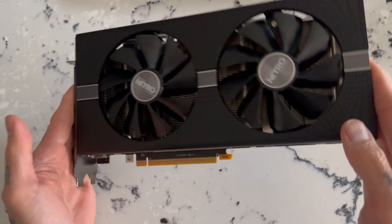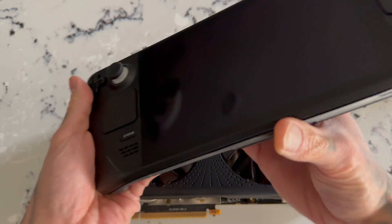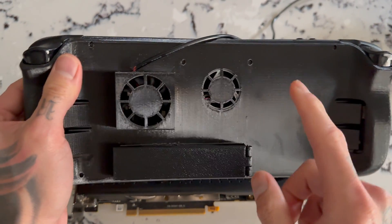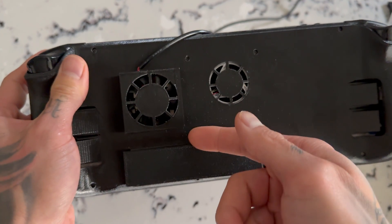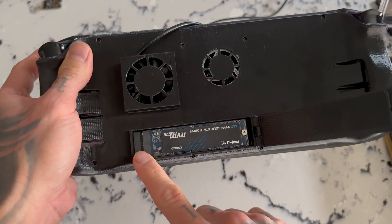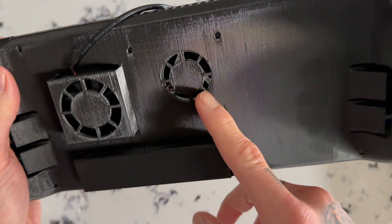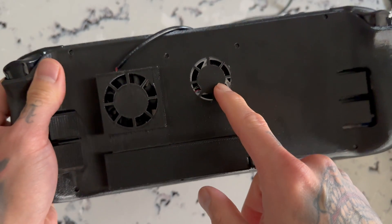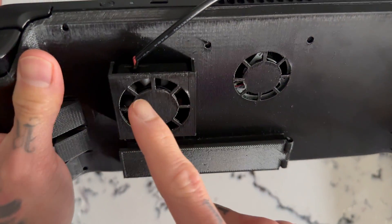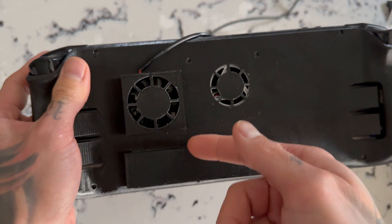Now let's take this aging beauty and kneecap it by plugging it into a Steam Deck. To do this you need access to the M.2 port inside the Steam Deck. I 3D printed a backplate that has a cutout allowing you to plug in a full-size M.2 using two M.2 extenders from the main board. There are two cooling mods on the backplate: a vent mod for the internal fan and an external fan attached to the backplate, since the heat shield is no longer there.